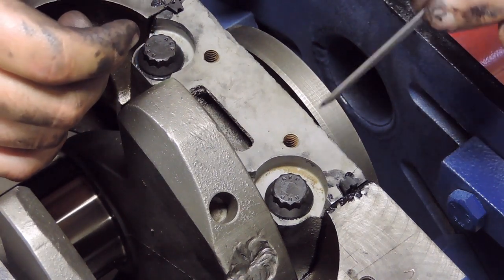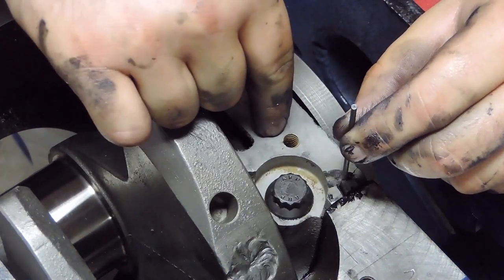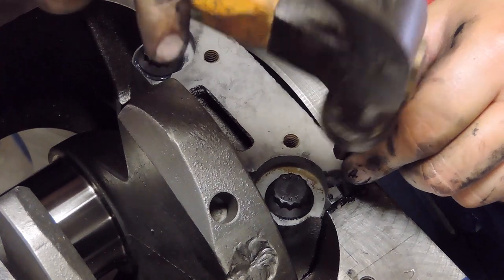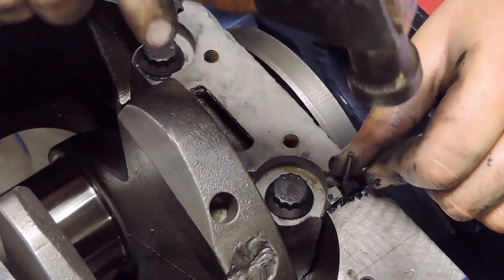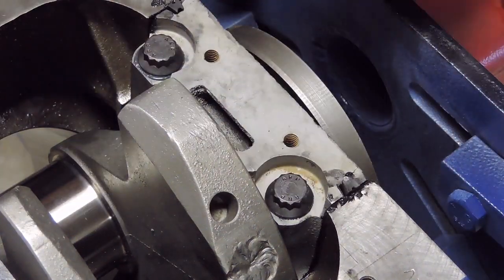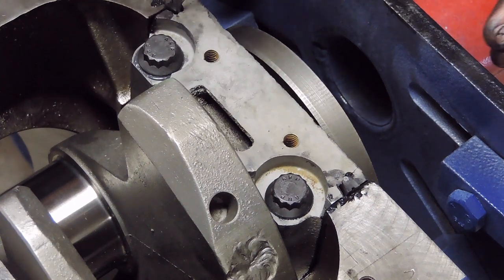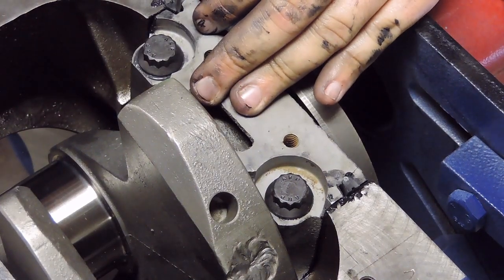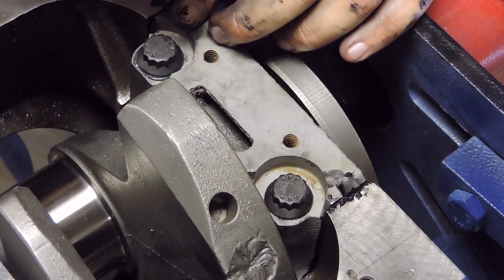So what I'm going to go ahead and do is take these two pins. They install right here on the cap side of the seal, and you just drive those in, which wedges this seal in to create a nice tight seal. So I'm going to get that as flush as possible on that side. I'm going to go ahead and start this one. Not want to do that. If you want to hit these in straight, don't do what I just did and slightly bend the nail over.